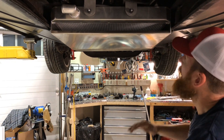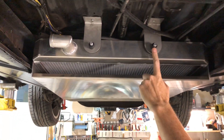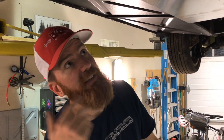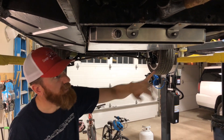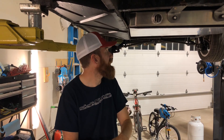More about this radiator setup — you can see it comes with brackets and rubber isolator mounts, so it's not rigid in the vehicle. It's got isolators front and back. They give you dimensions — it was a kit made to be installed without thinking too hard. They've done all the work, tested it, proven it. I couldn't be happier. It is what I wanted in the first place. The radiator is mocked up, we've got to drill out and put in a few more riv nuts — we didn't want self-tapping screws, we wanted nut and bolt properly torqued down. Thanks for watching, don't forget to subscribe.